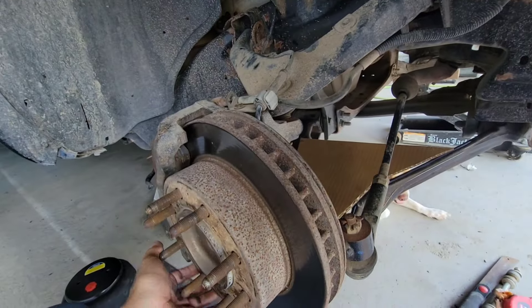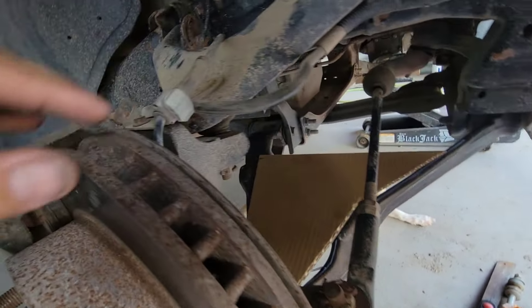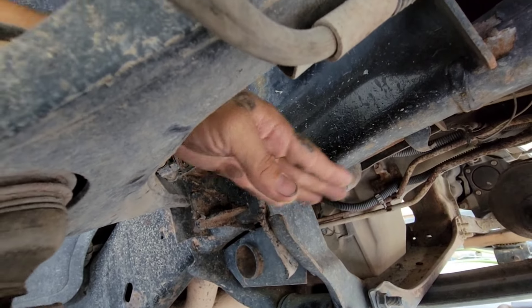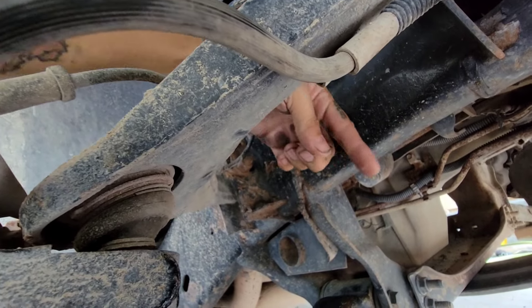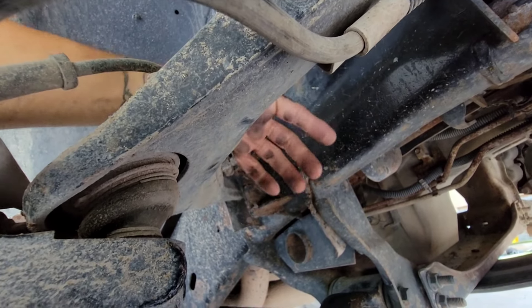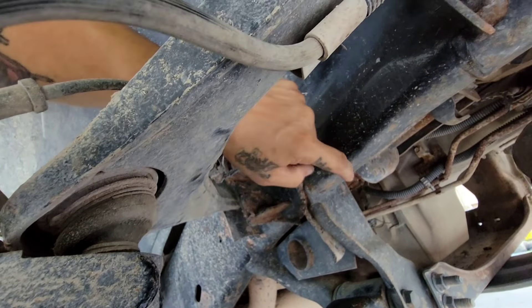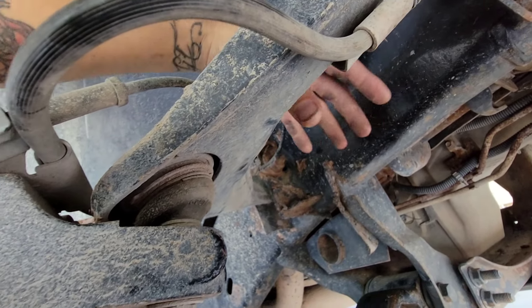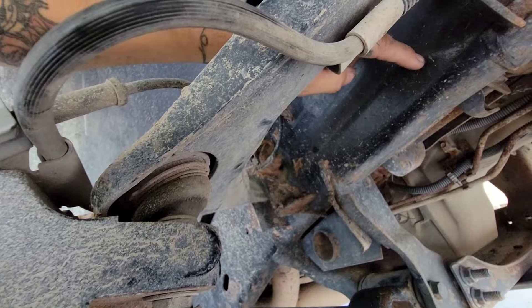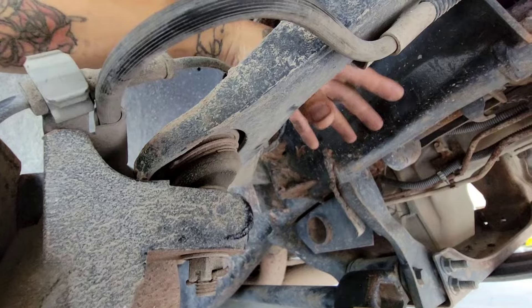Right here it's all the way down extended, so it's going to go up and level out. That's where the bag is going to sit right there on top, and the other mount would go from the bottom of the chassis - basically shaped like a capital D. Just have the six-inch diameter plus a little lip so I can weld underneath the chassis, then make a little wall around it so it doesn't flex - welded to the chassis on the bottom and all the way around, basically like a cup. That will be the top of it.